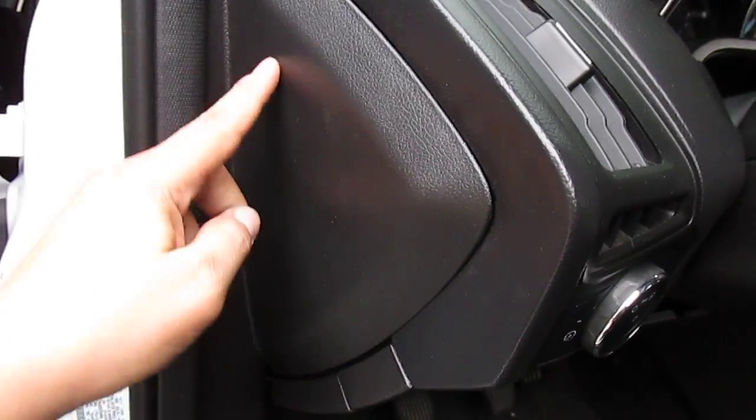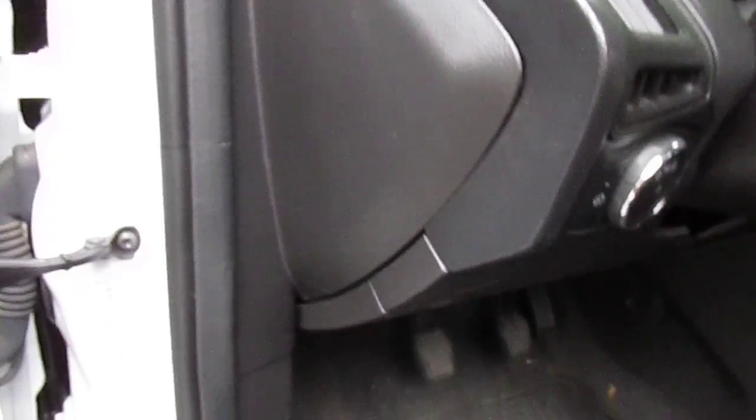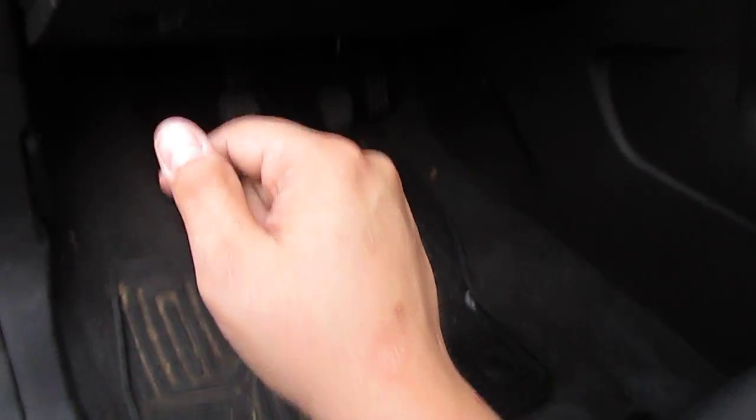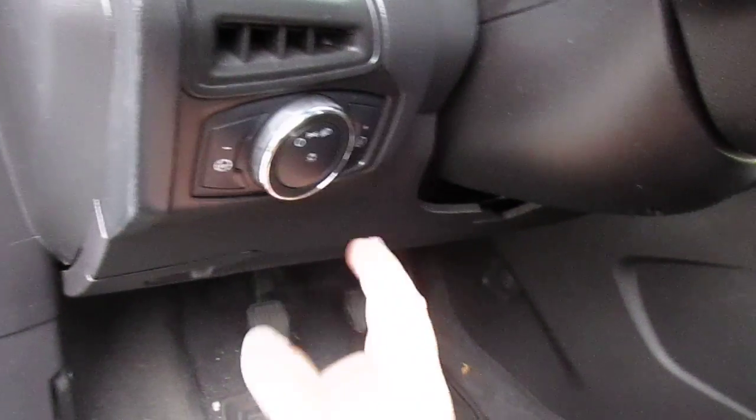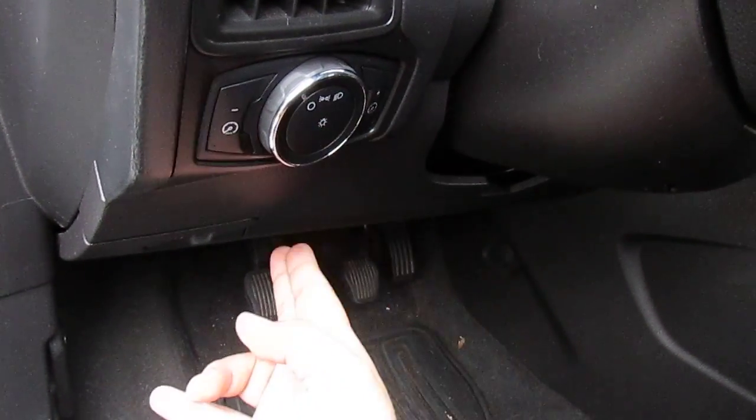So behind here, there's a little opening that you can see in. I have my relay mounted. So when you go ahead, you turn the key to accessory, the ignition powers the relay. The relay is pulling power straight from the battery. Okay. Then from when the relay turns on, it sends the power straight from the battery through the other end of the relay, down through here. It just follows the power cable.